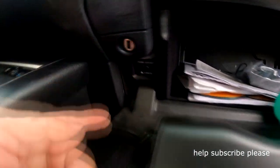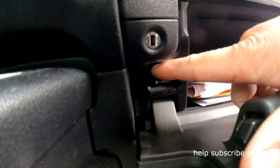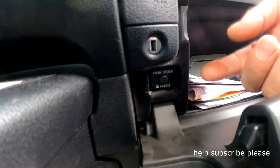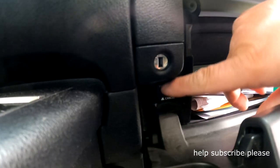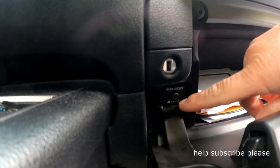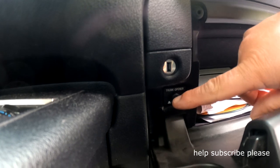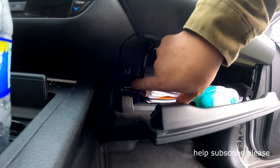Here's your glove box and glove box opener, and down here you'll see the trunk cancellation switch. If your trunk cancellation is pushed in like this and your trunk doesn't work with the remote or manually, then you need to check further. But if the button is pressed out like this — not pushed in — that means you've cancelled your trunk, so the remote doesn't work. This is useful for example if you go to valet parking and you cancel your trunk.